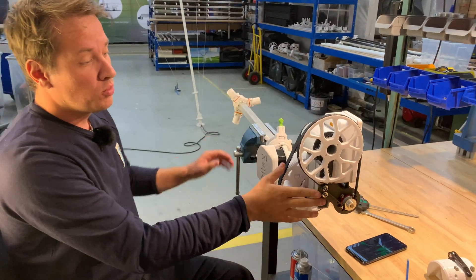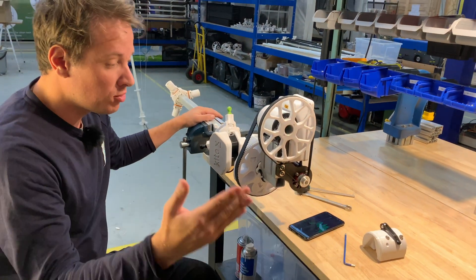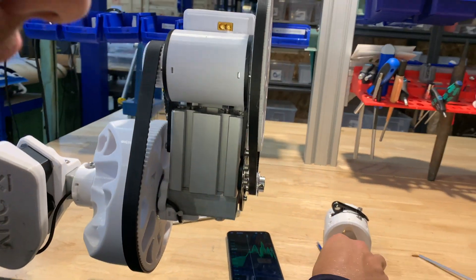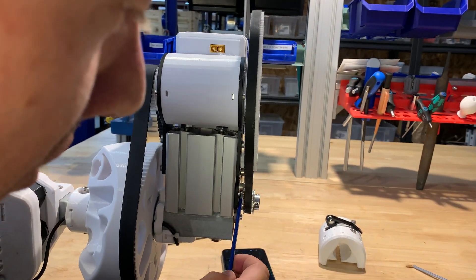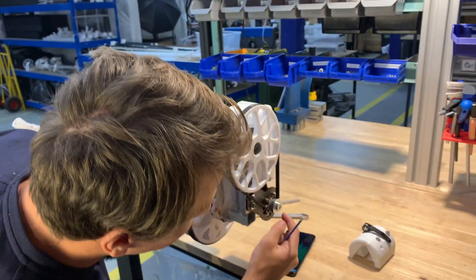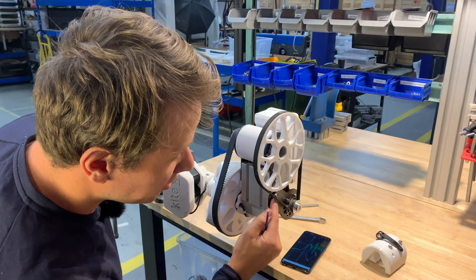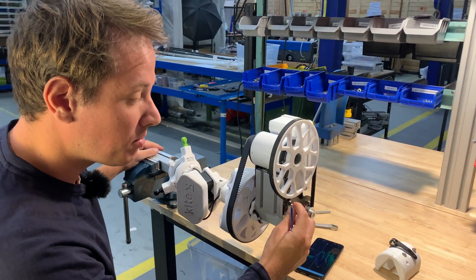Be mindful when you're doing this that the pulley position matters in here. You risk riding on the bolts themselves. If that happens, the pulley needs to be flushed to the shaft out here — that's a good indicator. If it's too far in then it will ride the bolts. So be mindful that it's not rubbing in there.